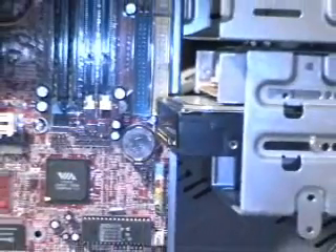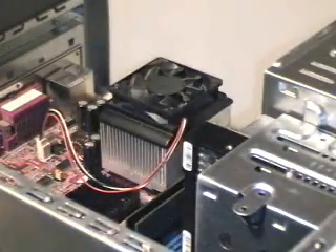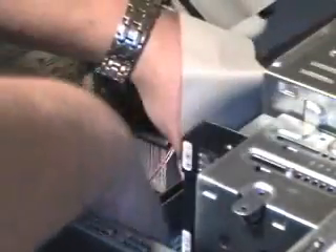The one below it is IDE2, which would be for other optical drives — CD-ROMs, burners, etc. What we're going to do is put the CD-ROM cable on first since it's the lowest one — that way it's just a little easier to do. You'll notice the cables have a stripe down one side, and some have a little notch that isn't on the other side. That is also important — they make them idiot-proof so literally anybody can do them, but sometimes you don't get so lucky and there's no notch. The stripe indicates the power.